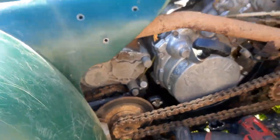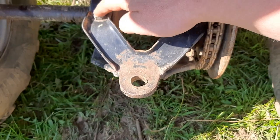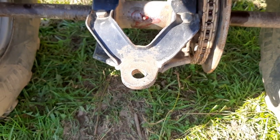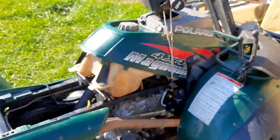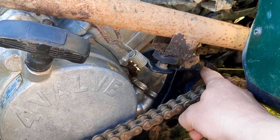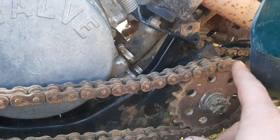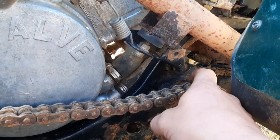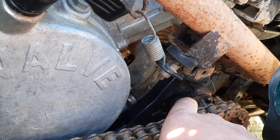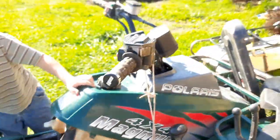There's a chain tensioner block in the rear. I'm kind of getting off topic here. So basically you loosen up these two bolts and then you twist this portion to tension up the chain so it's tight. And similarly, there's one just like it over here. So you gotta loosen the two bolts that hold the elliptical hub, and then there's a little lug here you can set a brass punch or something against and move it. So very simple design, quite reliable.